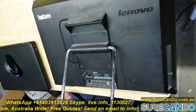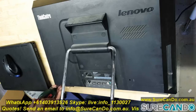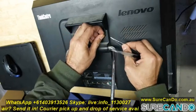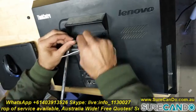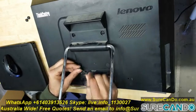It has 2GB RAM from factory, which is ridiculous, and is currently running Windows 10. We're going to upgrade to 4GB, but we can only use 3.2GB with the 32-bit system. I'm not going to reformat it because there's some software on there which we cannot reinstall. To remove the back assembly, remove four screws over here.